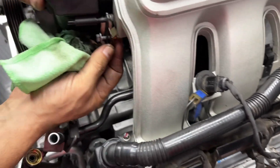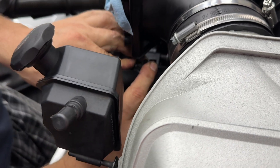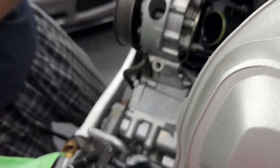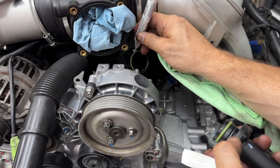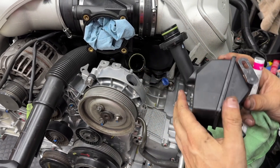I think that thing mounts over to — oh look at that. This one's here because I remember on a different engine, on a 996, I had this crack. It was a fairly simple replacement, except I remember this was a pain to keep the threads lined up. On my 987 it doesn't screw on — it just kind of twists and locks, so you've got to get it aligned right. Let me spray it. So that aligns with that, and that aligns roughly with that, so if I can get that nub into that nub...